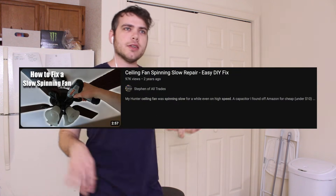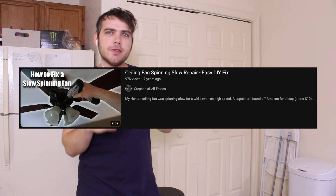Hi, I'm Yonash. This is a variety channel because I hate specialization and I get bored easily. I've already attached the light part of the fan. If you want to skip this intro sequence, I do have chapters. Basically, the fan's not turning at all. I came across a video where the thumbnail looked like the same type of fan I had, and they said a common problem was the capacitor failing.